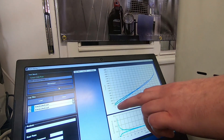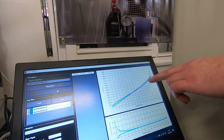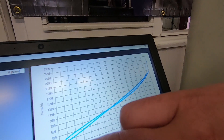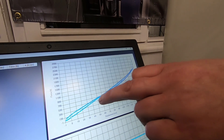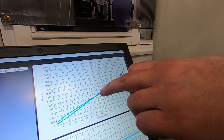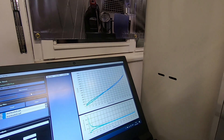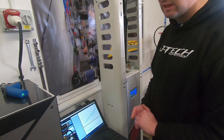As you can see, the coil spring gives a nice linear curve, and then just towards the end you can see it's starting to get progressive — that's the air pressure build up in the lowers. Compared to the air fork, we have a softer initial part of the travel, very similar through mid travel up to about 60mm, but then firmer through the last third, and it actually ends at a very similar point.